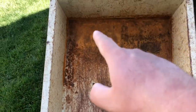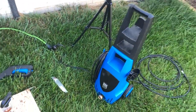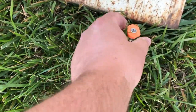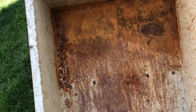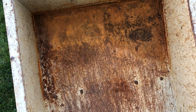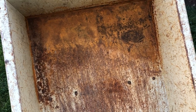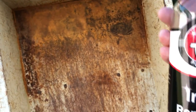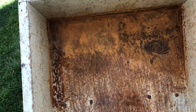What we're going to do is restore this using Rustoleum's truck bed coating. But first I want to get all this rust out. I'm going to use a Harbor Freight pressure washer, probably a 25 or 15 degree nozzle, and an industrial fallout remover. I'm not going to use my expensive industrial fallout that I use for my cars — I'm going to use Adams Polishes, still a great remover, but I don't think I need something that heavy.